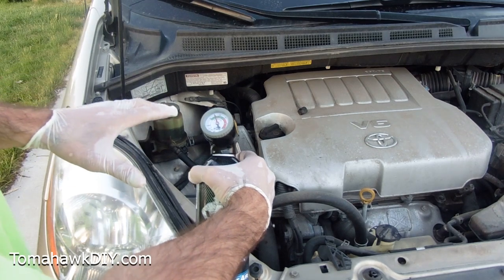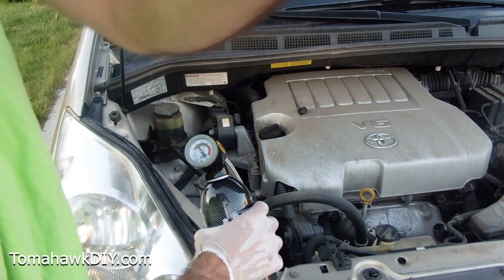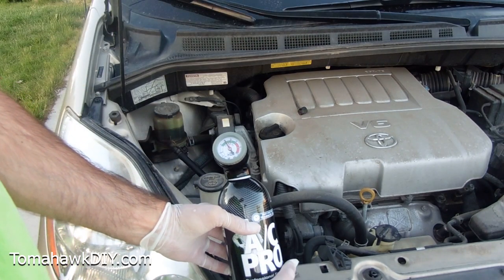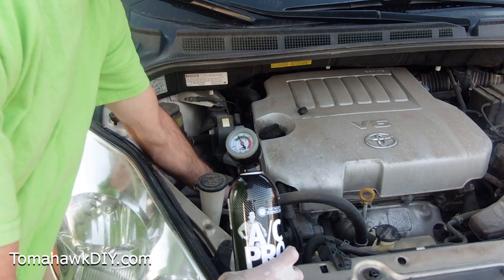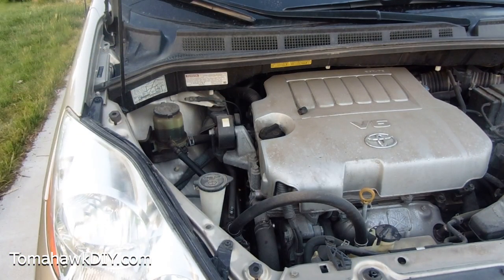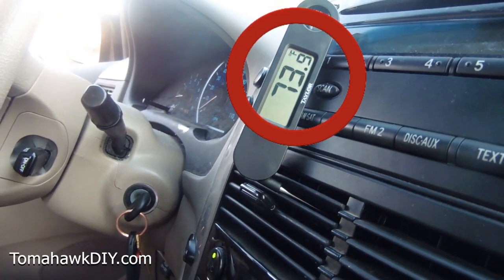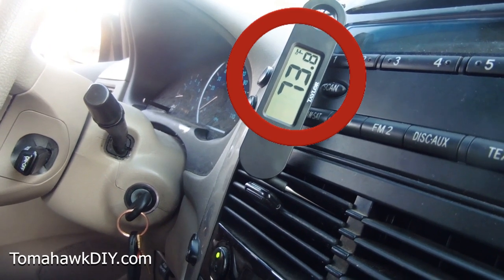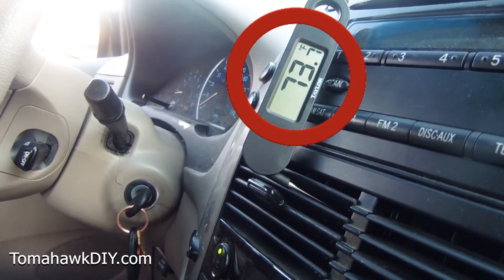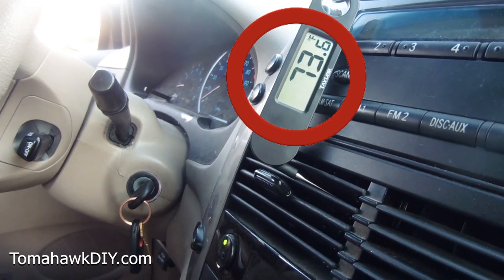Starting to get there. I'm going to take a pause and go check the air conditioning temperature inside. Remember, I'm not going to set this thing down on the hot engine. Disconnect it and move it away. Now inside the vehicle, the temperature is dropping — we're about 73 degrees right now. When this thing's operating correctly, we ought to be down around 50, maybe the high 40s. I checked my other vehicle earlier today and it was about 47.